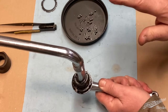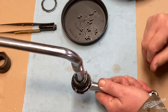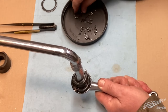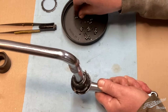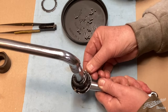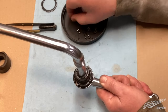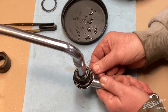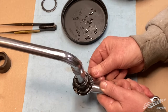To get the second one in, I actually put the split ring in all the way and then have it sitting down on the bottom. Now I can put my pawl back in and just ride this up over like that. Now you can see with that spring compressed, I've got my pawl action there. The next thing I'm going to do is put the ball bearings in the bottom. I counted 35 ball bearings on the bottom and 35 on the top. I don't know if that's the right amount — I could be one off plus or minus either way, but this is working for me.